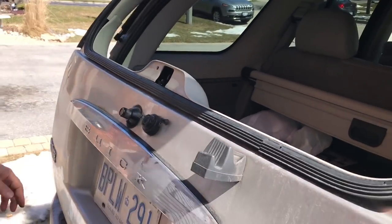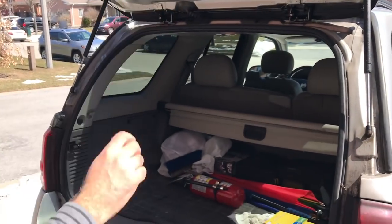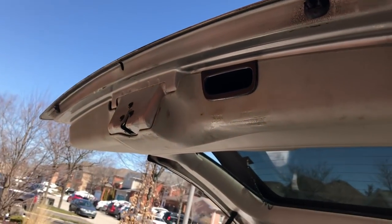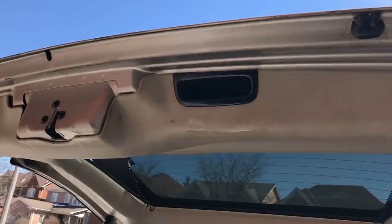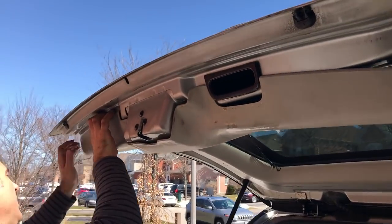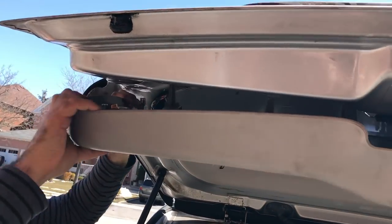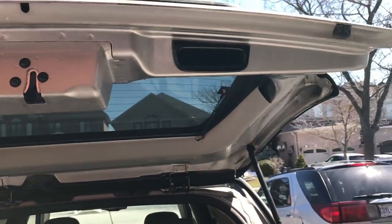Now what we're going to do, we're going to pop this open and lift off this panel. This panel has no screws at all in it, other than that one plastic plug I showed you earlier. So basically you just pop it off from the sides here, get a little grip in there, and you'll see it start to pop off — very similar to door panels. Same idea. Door panels usually do have a couple screws; this one has none at all. And then you just pop this off.